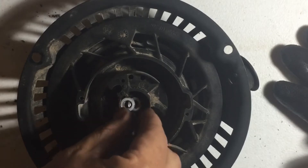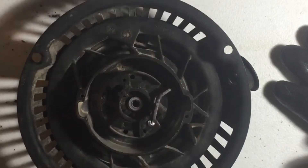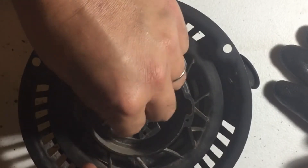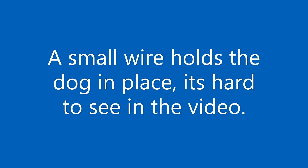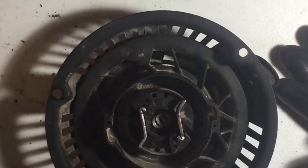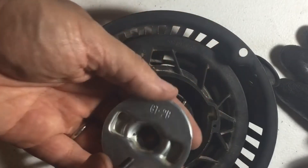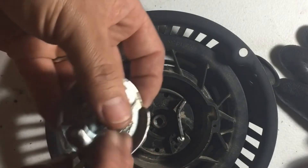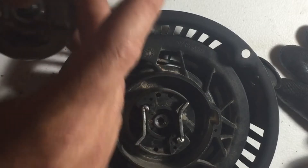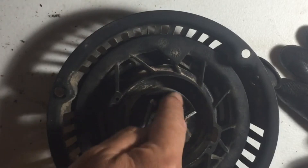The washers should line up like so. These dogs face like this — they're molded to fit in the frame. The washer goes back up; you should have the spring on the bottom of the cup, bolt goes through the top. These little raised-up areas are what actually throw the dogs out — when you pull the rope, centrifugal force causes this to spin and forces them outward.